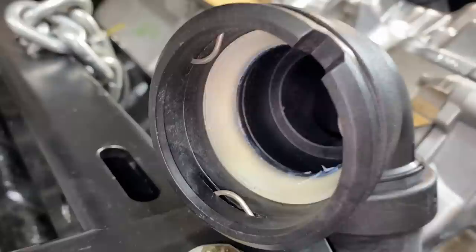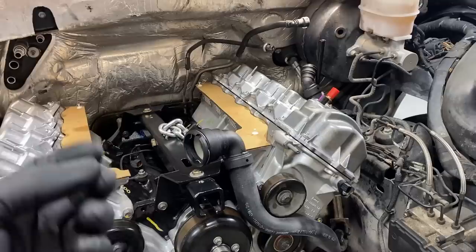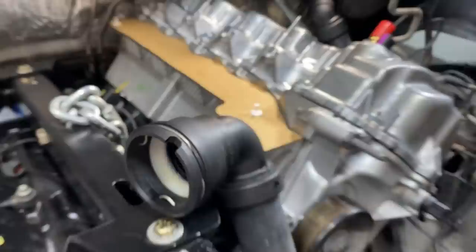These big hoses use a single O-ring on the inside. I do not understand why, because the heater hoses we've never had coolant leak issues - you can pull them off and put them back on all you want - and they have double O-rings inside, never an issue for 20-30-40 years. The 6.4 diesel Power Strokes have these upper hoses right in this area that leak all the time just on their own, and guess what - the service replacement hoses, the upgraded re-engineered parts, had double O-rings in there to fix the issue.